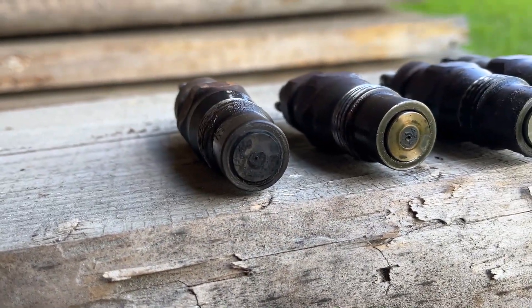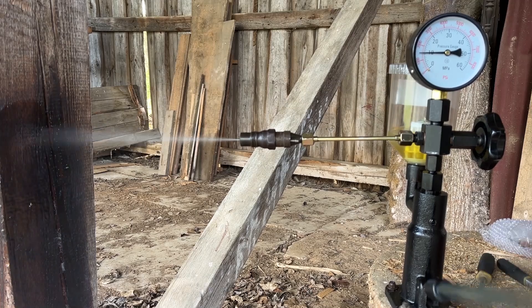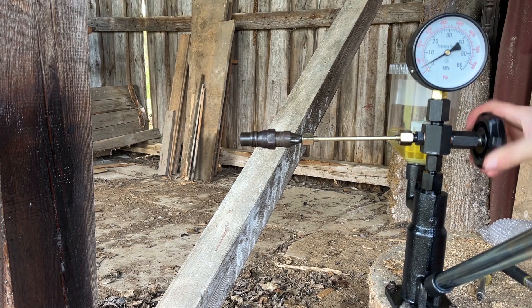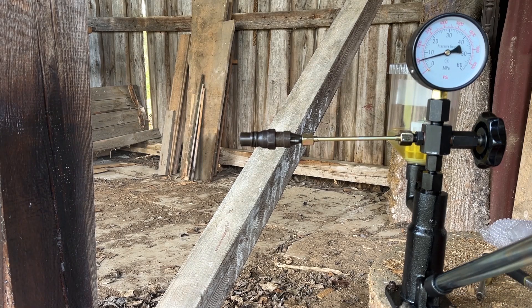First, the dirty one. What am I exactly looking for? I can see a few loose occasional streams outside the spray pattern, but are those bad? What should they look like? I was expecting only a drizzle or crazy spray in all directions — it kind of looks fine to me. And the pop pressure is 1500 or 1600 psi. Is that okay?